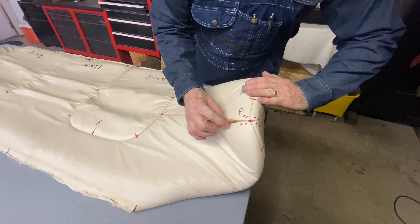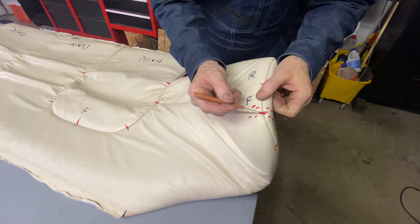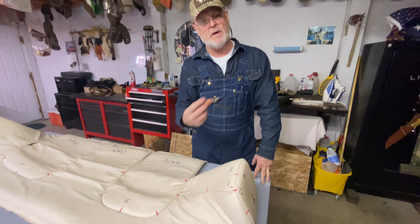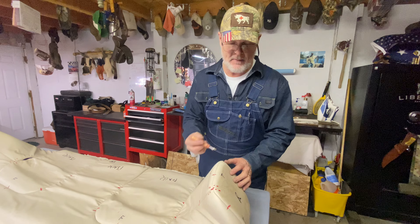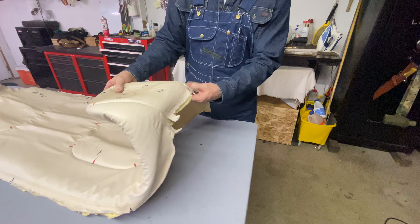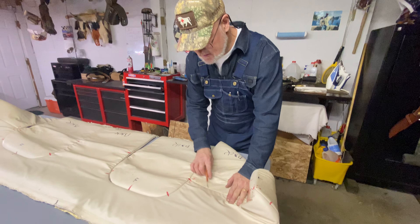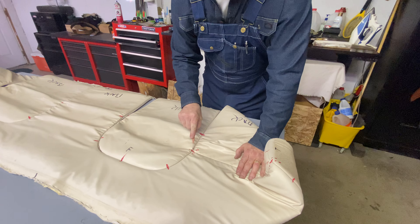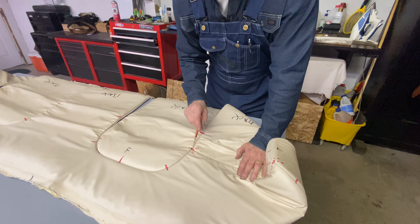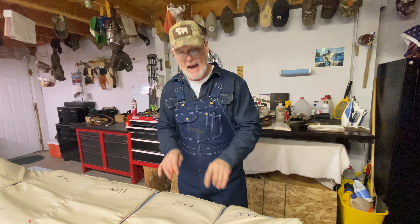You see where this meets in a field? I mark that. And then I put two marks, so I know that's where that meets, and then I will create my own witness mark. There might be old witness marks, and there might not be. So I make sure that's where I'm going to put my witness marks — one, two, three — and then you don't have to worry about that. And right here, see where this seam meets this curvature? I'm going to put a witness mark on this panel, so I know where these two meet. We're duplicating. Get into the habit of doing this.